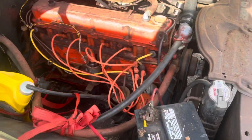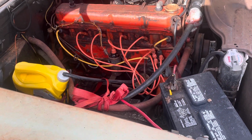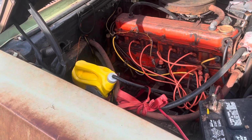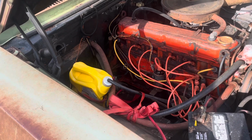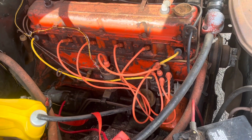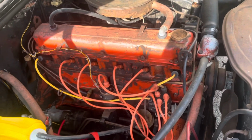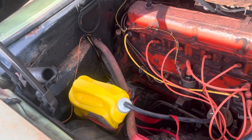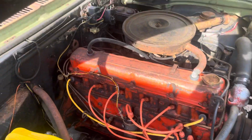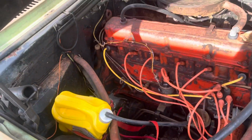And this car does actually run, fires right up, and I've driven around the yard, but the brakes are pretty crap, so that's really as much as I've done. But yeah, I bought this car running and yard driving. I had to put a little bit of transmission fluid in it, and I threw some power steering fluid in it. It's a pretty bare bones car, other than it does have power steering, but manual brakes, drums front and back, and then just a base model inline 6.